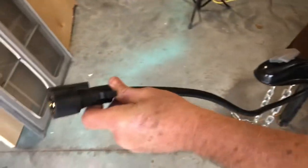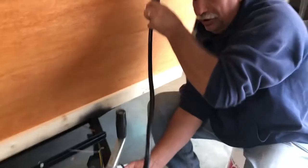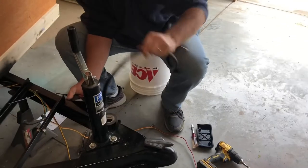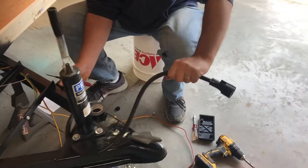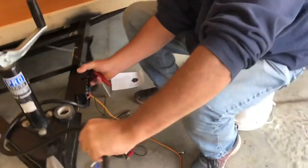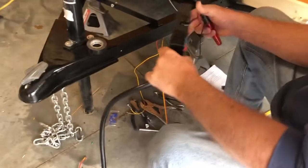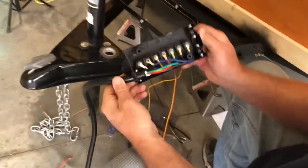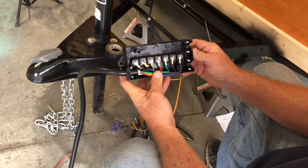You want to leave plenty of room to reach any vehicle. If it's too long, you can always go around the jack a little bit and that shortens it. But I've seen so many cords put on that were too short they wouldn't reach. So this junction box, for those of us that have never done it, there's going to be a couple in there for the trailer brakes and then the rest are going to be for lights.